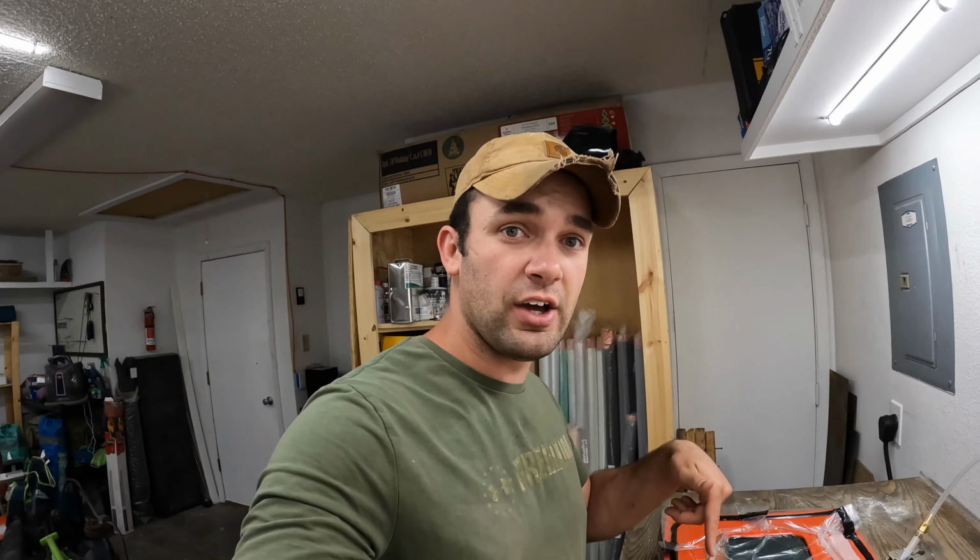All right, so here's our clear. We're gonna mix 4 parts clear, 1 part hardener. So I'm just gonna go 5 ounces: 4 ounces, 1 ounce. If we need more, we'll mix more. We should be okay, hopefully. All right, 4 parts clear, 1 part hardener.